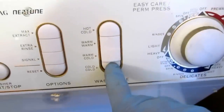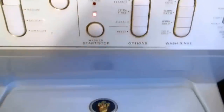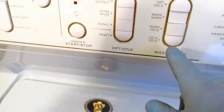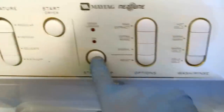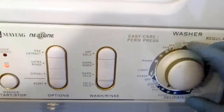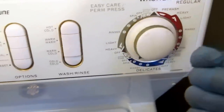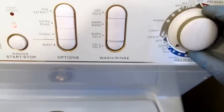Turn it on, I'll go through the different cycles — basically blowing all the air out through the lines into here. They'll dump the antifreeze and I'll dump it. I'm going to get this so that it's on the spin cycle and then that antifreeze will dump, mix with the water, and then dump down a trap. That's how you want to rinse that — I'll let that go.